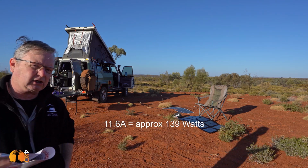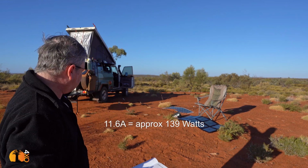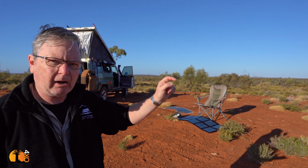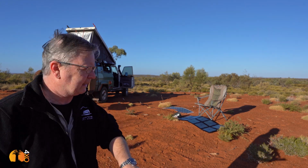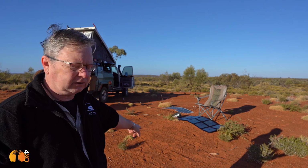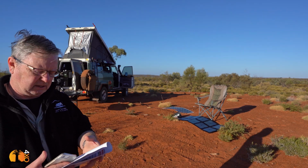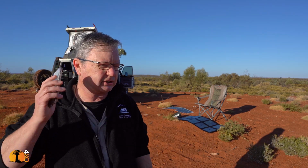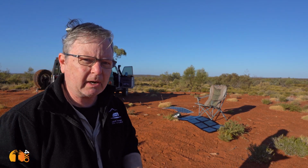And so the theoretical maximum, if you've got your setup really good, like I've got in here, a proper solar charger, a power point tracker charger, not a regulator. Okay, more about that later. A power point tracker will look after the battery and it will look after the panel, which you can see now has fallen down. Okay, so with all of that in mind, this panel will produce 11.6 amps on an extremely bright day, which is a nice healthy amount of current.